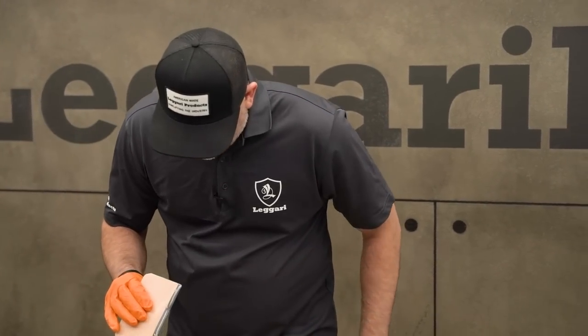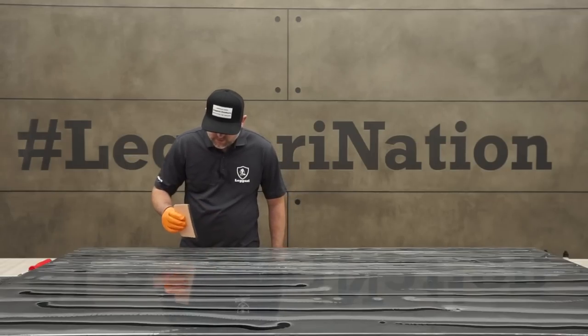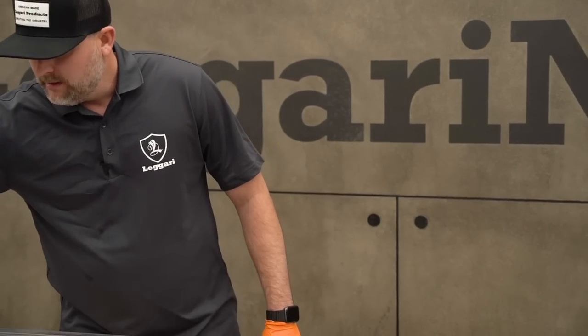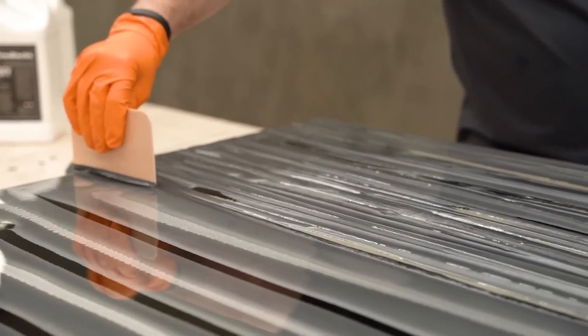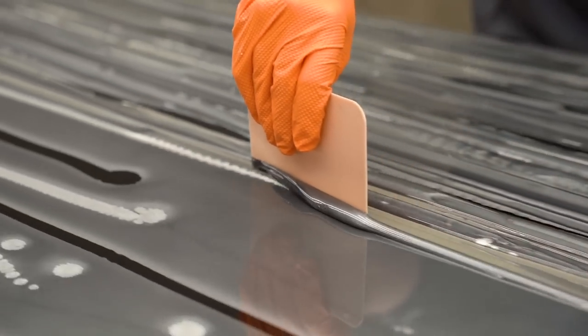And what I mean by that is I'm down to just primer right here. Right, we don't wanna turn this thing really sideways and blend it and push that product really far away from each other and expose that primer layer. And I'm also going very straight.